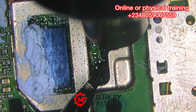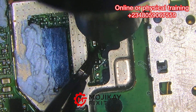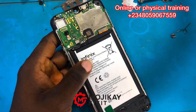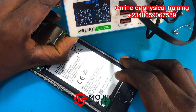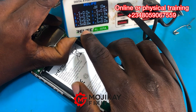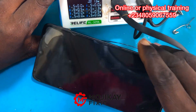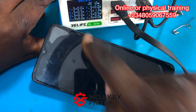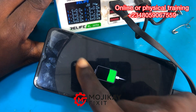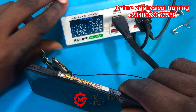We're currently getting 3.5 volts on that line. One possible cause is the charging IC itself, so I'm tapping gently on the side. After that, we'll take another reading with the charger meter. Plugging in the charger — the charging LED is now displayed. The charger meter is showing 0.5 amps, then going up to 0.7 amps. Previously it was around 0.6, now 0.7 — fluctuating. That means the problem is not solved.